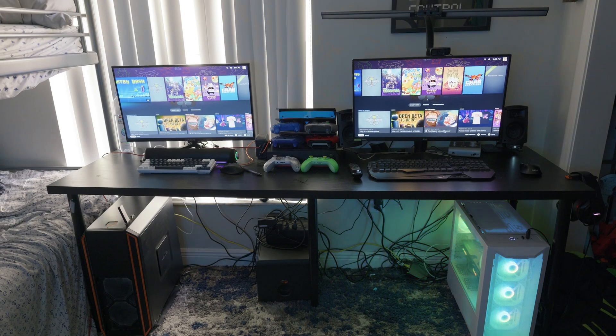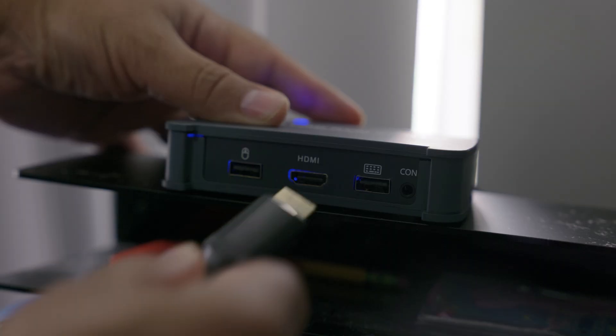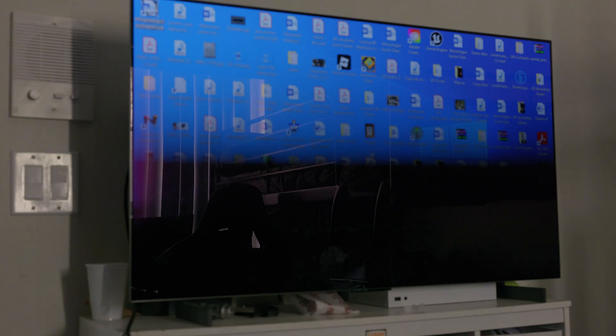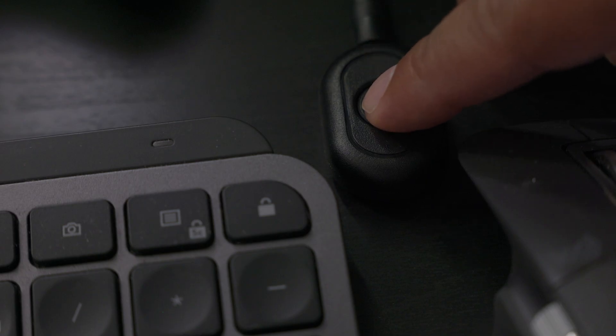Practically speaking, I took this KVM switch to my kids' room where there are two computers — one with a 1080p monitor and one with a 2K monitor. I unplugged both monitors, plugged the HDMI and USB cords into the first computer, then did the same for the second. Then I got a 15-foot HDMI cord, connected it from the switch to their 4K TV, and immediately both computers recognized a 4K display. Checking display settings confirmed 4K at 60Hz on both computers.